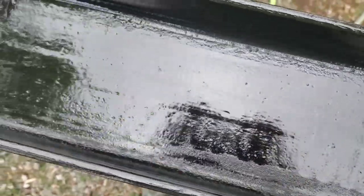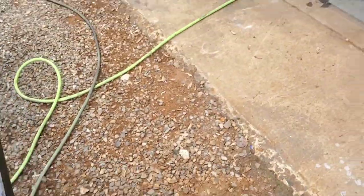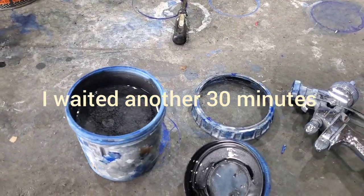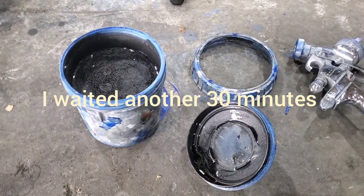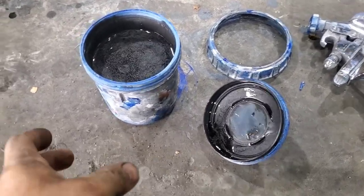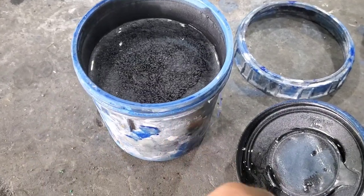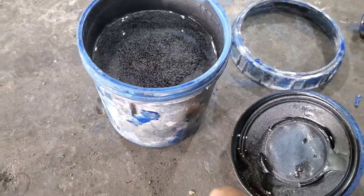There are gnats flying around in here and gnats have really killed me on paint lately - for some reason the gnats this year are way worse than they've ever been. The primer is pretty thick right there and it's kind of tacking up and looking good. I'm going to go ahead and try to spray the base - it might be a little early but if it doesn't turn out perfect it's not a big deal, it's just a trailer. I went ahead and mixed about two-to-one - two parts paint to one part thinner reducer.